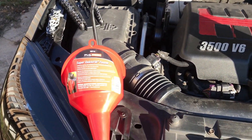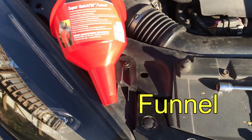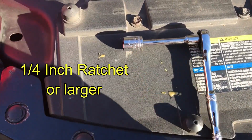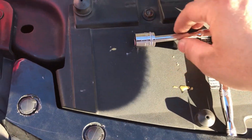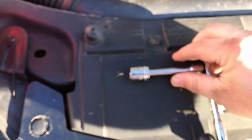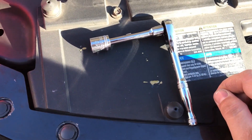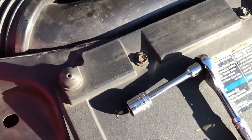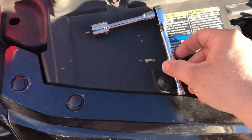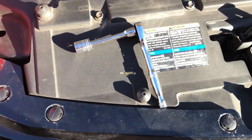After you've got your car up on the lift, you're going to want to make sure you have the following: a funnel, a ratchet along with a size 13 millimeter socket, and you might also want a smaller ratchet — I think it's a quarter inch drive — but it's pretty small and not very durable, probably only used this one time.